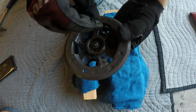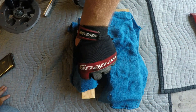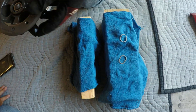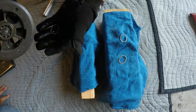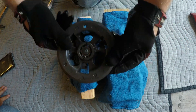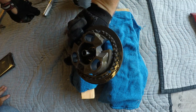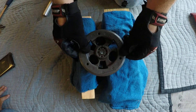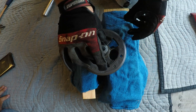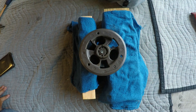If you look in here, I was talking about the washers. These get transferred over to the new pressure plate — not the clutch plate, it's actually the pressure plate. Then you have to bust out this bearing, and this post gets transferred over to the new pressure plate. So you end up having to have a bearing race kit — that's what I went out and bought. Or an arbor press if you have one.